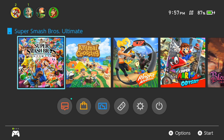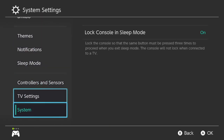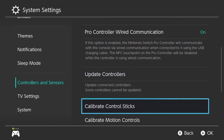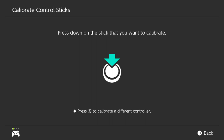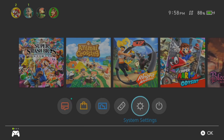Here's the procedure. They say to do this undocked, but I'm doing it docked so I can capture and show you how to do it. You want to be connected by Bluetooth, not by USB. I'm connected wirelessly with the new pro controller. Going down to calibrate control sticks — clicking on the left stick, you can see there's a big drift off center, downwards and to the left. Very annoying problem to have, but here's the solution.